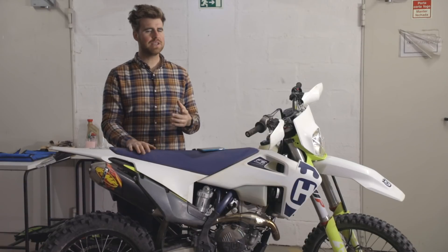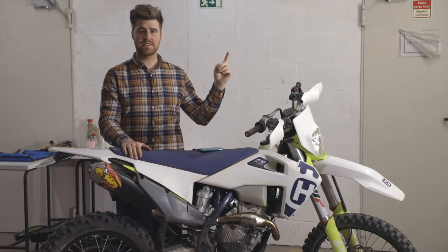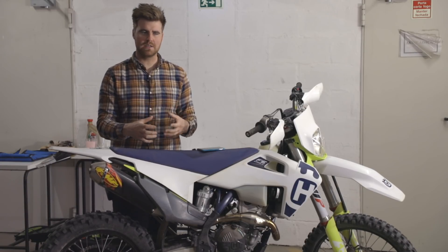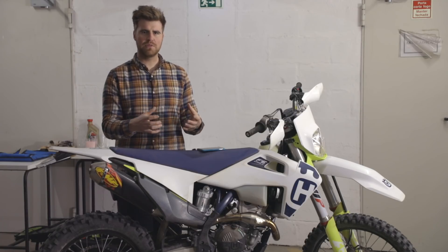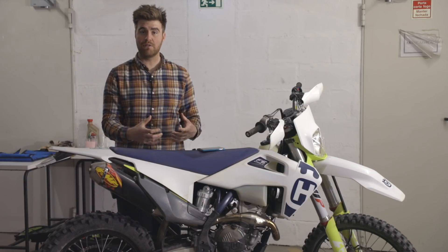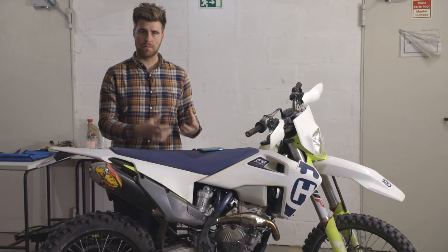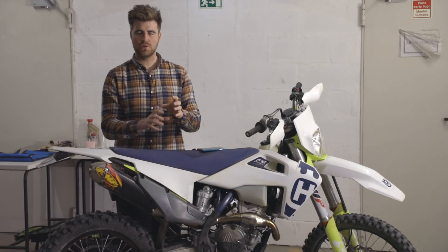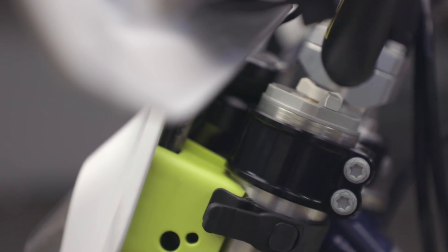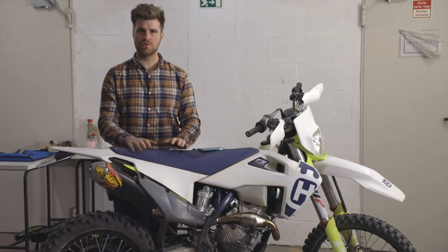If you're looking for more information on how this is done, we made a video about basic suspension setup — you can watch that up here. For my weight we're going to need to change the suspension springs. Most dirt bikes come set up for someone between 75 and 85 kilos, and with the standard springs you can get it working in that range pretty well. I weigh a tiny bit more than that, so we will need to change the springs at some point. If you're a little bit heavier you can increase the tension on the rear spring, drop the forks a little bit — it's a kind of dirty hack to a similar solution. Long term it's not the right thing to do, but for now it'll do just fine.